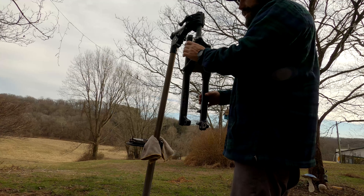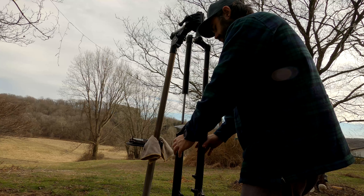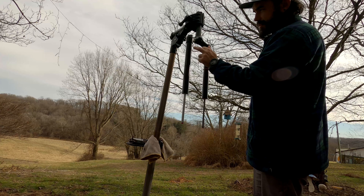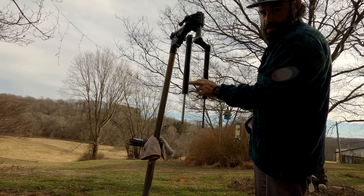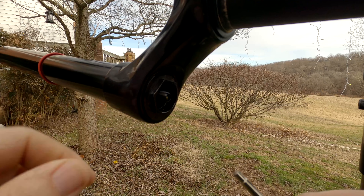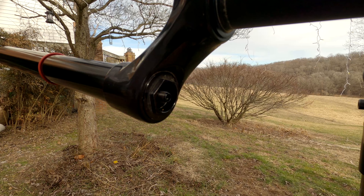Now we're going to pull the lowers off of the stanchions. They broke away free — nice and easy. This is your air piston and this is your rebound damper right there. Your compression damper is up in the top of the fork — it's an open bath system, so it's all oil going through orifices in the compression and rebound damper. The rebound damper has been leaking for about two years. What I like to do is use a Schrader puller, push down on it, make sure you have no air in there, then pull the core out so there's less negative pressure fighting you when getting the air spring out.